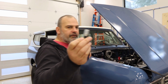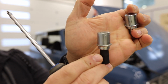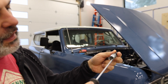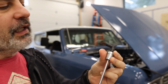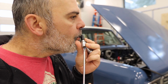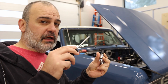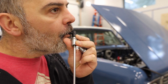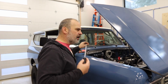This is the PCV valve that I put on the Chevy engine. It's sort of a bog standard PCV valve with the pintle valve in it. The way this works is, at idle you have the most vacuum, so it sucks that pintle valve up and restricts it. But then as you lose vacuum, it opens up more until it gets no more. So there's like a curve. At idle, it's restricted, and then it opens up, and then at no idle, it's totally closed. So again, it goes like that. This is functioning properly, but it goes up and down based on vacuum.